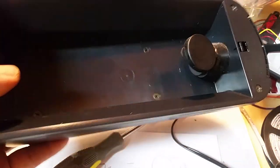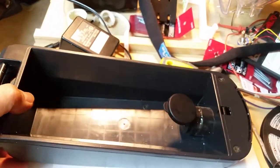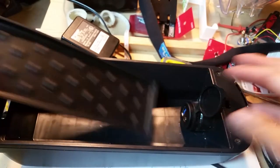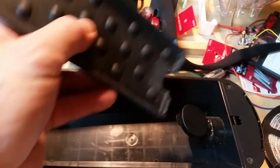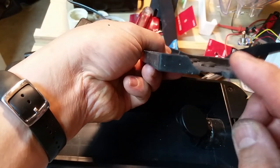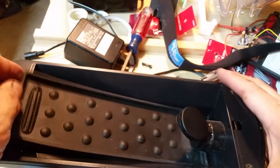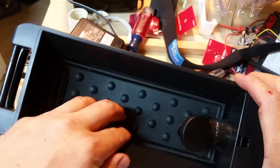There's one other thing I noticed: because this has to be mounted so low to give clearance to the push button, I won't be able to get this pad back in. I'll have to trim around the edge here a little bit so I can slide it back in. To get it to fit with such close clearance on the bottom, I had to actually use the Dremel to thin out this piece right here. Now it fits — it's actually a nice tight fit in there.